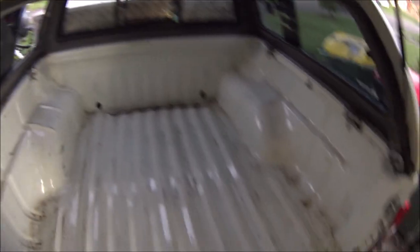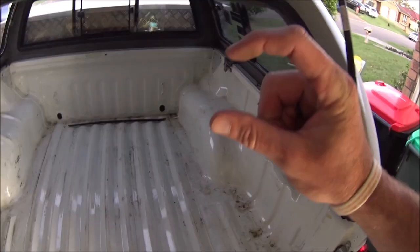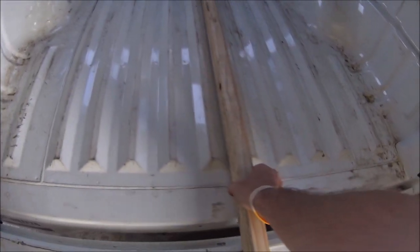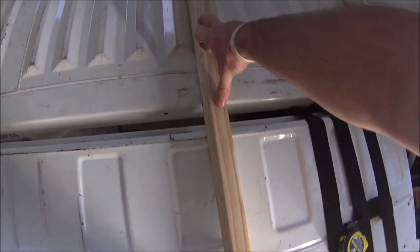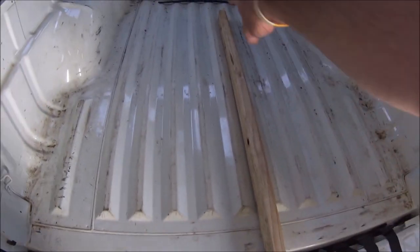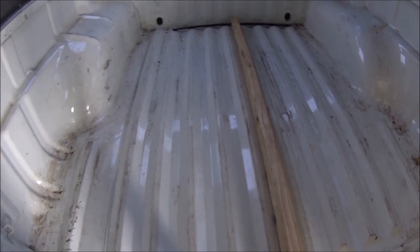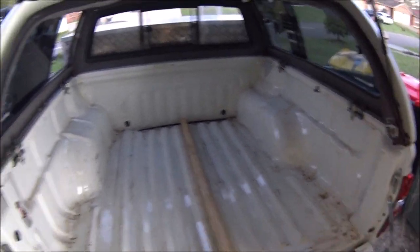The sheet is 1500 wide, which is the width from one upright to the other. Corner to corner on an angle I've only got an opening of 1470, so it's about 30 mil shy of fitting in. I'm definitely gonna have to take this canopy off — I'll get the four bolts out and lift it up. I've also grabbed some 70 by 35 timber from work, which is the right width to sit down in there. I'll cut it into sections for the height I need, and probably put maybe one, two, or three uprights just to stiffen it up.